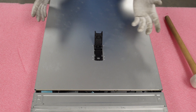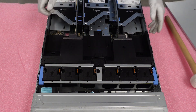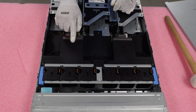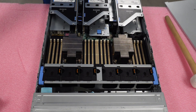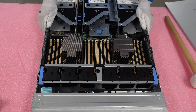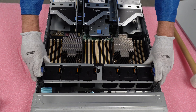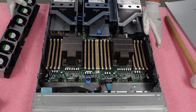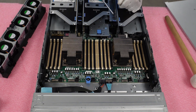We're going to lift the latch and take the cover off just like any other Dell server. You'll notice there's an air baffle or air shroud on top — this is CPU one and CPU two. It's very simple to remove: just lift it straight up. For the sake of this video I'm also going to remove the fan banks to give you a bit of extra view, though you don't have to do that at home. Now it's really just about grabbing your T30 bit and removing your heat sink.